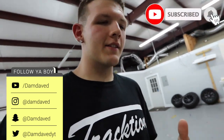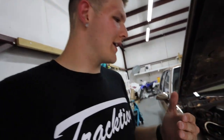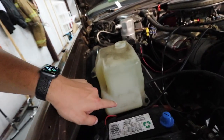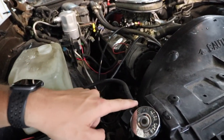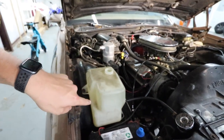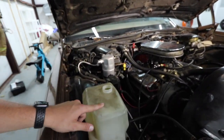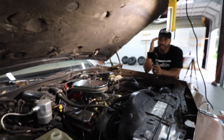I have come to realize something — I'm a dumbass. Last video we were talking about the coolant, and how I could have problems. I admit this needs a cap. If you don't know what we're talking about, in part one I said we need to fill this because there's no coolant in the car. But I didn't see that it said 'fill cold' and 'fill hot,' which means this is a spillover from the actual radiator — that's why there's a hose angling down. If it gets hot it should come up to these levels. What did I do? I filled it with water. So we've gotta dump it.